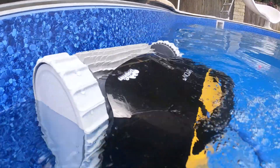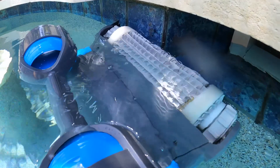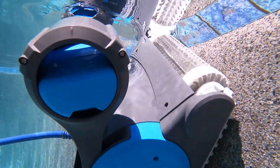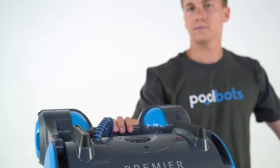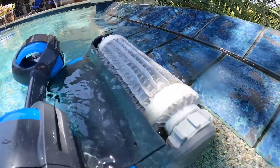The Triton PS claims to have waterline climbing, but in our testing it struggles to stay on the wall and clean once it gets near the waterline. This is in stark contrast to the Premier, which is the waterline cleaning master. The Premier has large motors found in commercial pool robots, delivering significantly more scrubbing power. On the rare occasion the Triton PS does reach the waterline, it struggles to stay there long enough to deep clean because it lacks the Premier's dual stabilizers. Stabilizers are important to waterline cleaning because they balance the robot's top-heaviness, which would otherwise pull the robot off the wall — and that's exactly what we saw with the Triton PS.